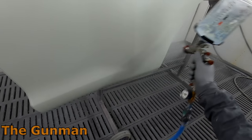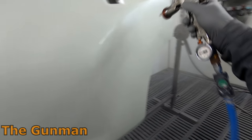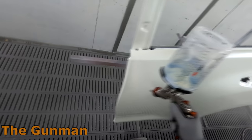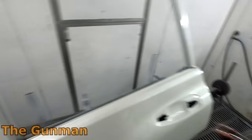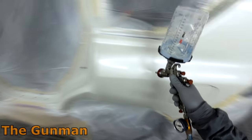There will be a link in the description of where to get one. We're actually going to do a giveaway on this gun too, so hang around to the end of the video for details on how to win one. As far as fluid tips go, I would say 1.3 is probably going to be the best all-rounder for most people looking at using the gun for base coat and clear coats. You might find it's a little bit too fast in winter — you can wind the fluid in to slow it down — then open it right up in warmer months.